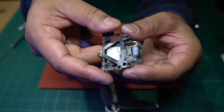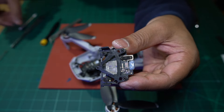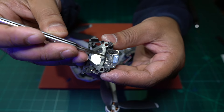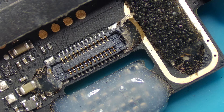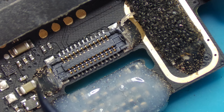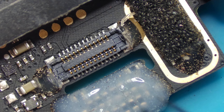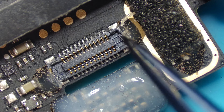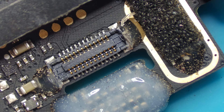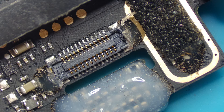I'm going to have to go under the microscope and clean up some more of this glue because the new connector seems to be slightly bigger than the old one. Here's the issue: there's still a bit of hot glue left on the corners of this connector and it's not allowing me to put the new connector on. If I apply heat here, it's going to make a hot mess. So what I'm going to do is flood it with alcohol and try to pick it right off.